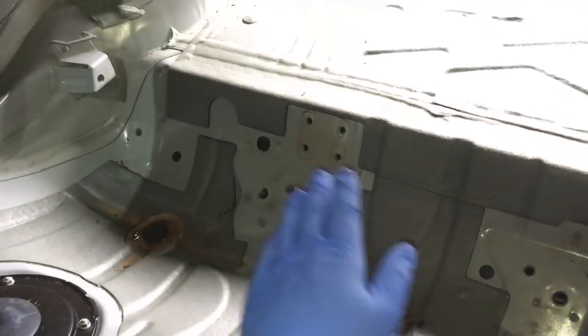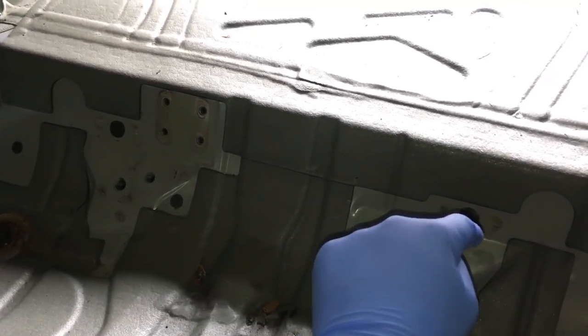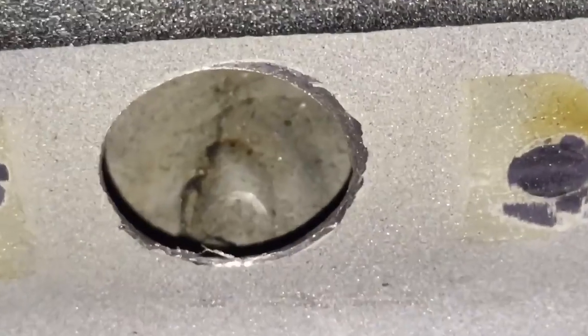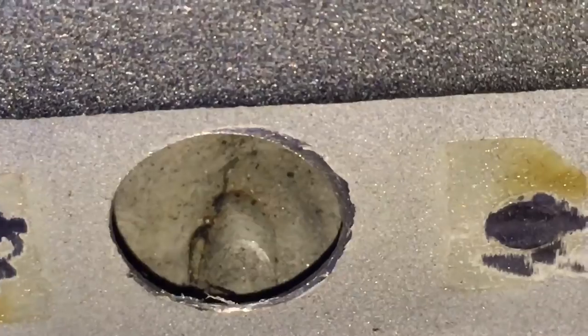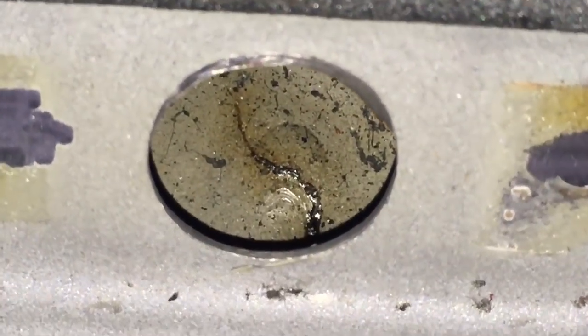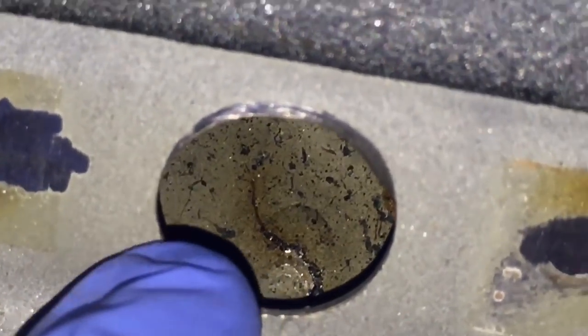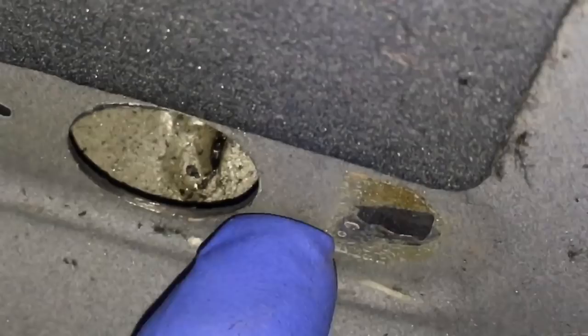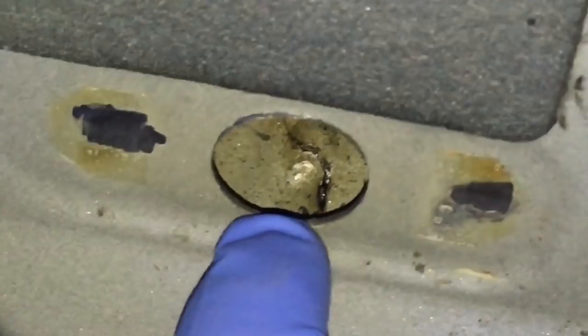We've also got some damages in front of the rear axle carrier panel. To address those, we're now in the car on the back seat area where the rear passengers would sit. We've drilled two 20mm holes through the rear seat panel to look at the top internal sections of the rear axle carrier panel front pair of MIG welds. We don't need a borescope camera for this one because the cracks are visible — this MIG weld has got a hairline crack coming out the front of it, and this MIG weld on the right hand side of the car is definitely cracked, quite obviously, with that black line and then a brown line drifting off towards the back of the car. That crack also travels towards the front of the car beyond our current view.